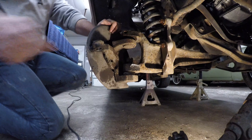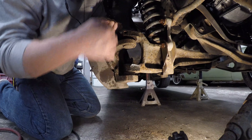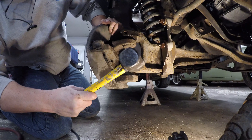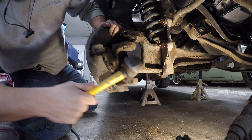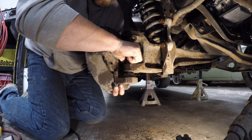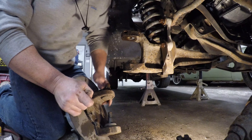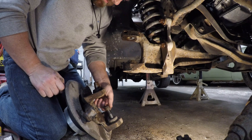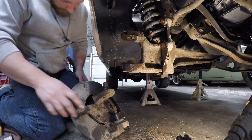I'm gonna do the same thing on this — hit the I-beam here, not the ball joint and not the knuckle itself, but where it's tapered into. Just like that — then you pick up on it, unthread your nut, give it a little wiggle, and then it'll come off just like that. Like I said, it saves you from having to get a pickle fork or ball joint separator, and end up messing up your boots so they leak everywhere. Just a little trick of the trade. But now I have to get this spring off.